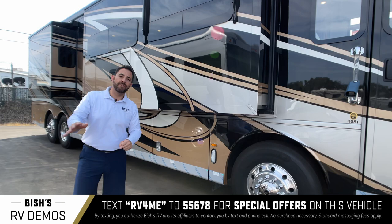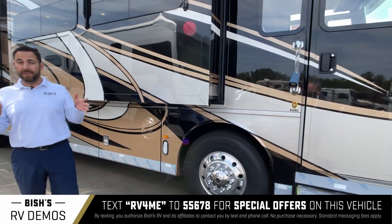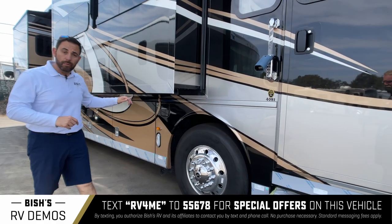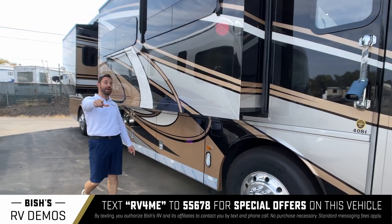This coach, being a 450 horsepower Cummins motor with an Allison 3000, gives you 1,250 pounds of torque, and is set on 315s for the tire size, all the way through the back, all the way to the tag axle. Passive steering tag axle, by the way.